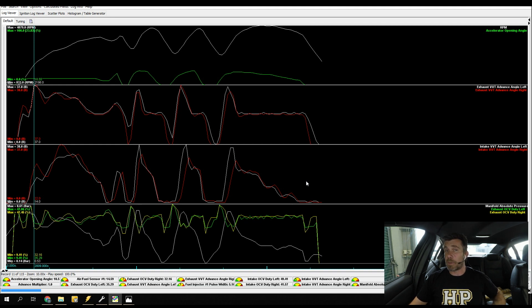This highlighted that we still had a problem on one of the exhaust cams, which was down to where I had modified the adapter harness. It turned out that we had reallocated a pin that was also doing another function on the factory dash. By disabling that, we've got our cam control functioning now. We're hoping to get this car on the dyno tomorrow and get a baseline tune in it with the Haltech Elite 2500. We're also going to be using that adapter harness to adapt this up to a range of ECUs - one we're really excited about is getting it up and running on our ECU Master Black, which a lot of people have been requesting content on.